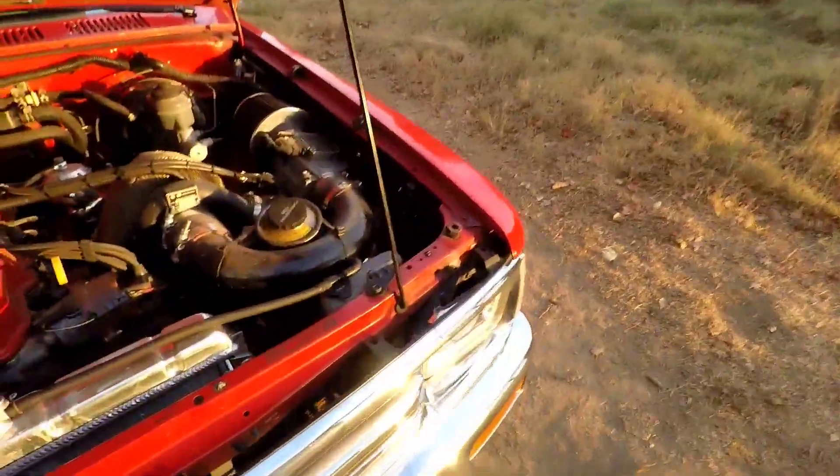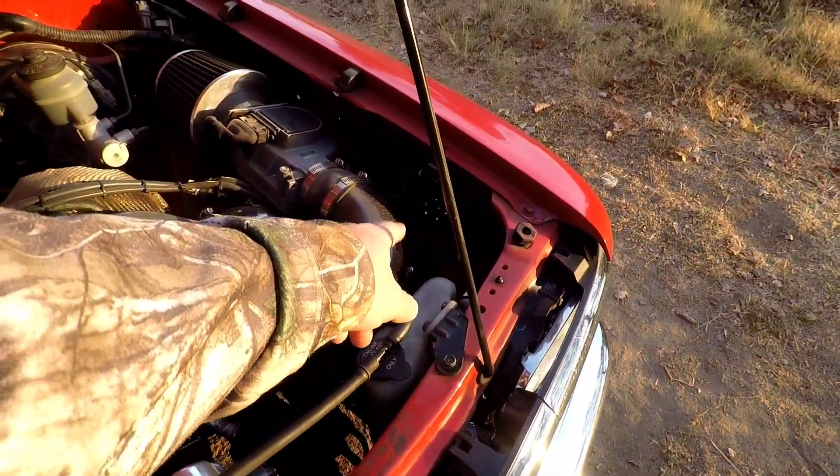That's what you need to make your little turbo pickup. If you have an external wastegate with a 4 psi spring, that's what it's going to make — no more, no less. I don't recommend this on a stock motor, but I never follow my own logic, so I went and got a TurboSmart screw-type boost controller and turned it up to about eight or nine pounds, and it does excellent.